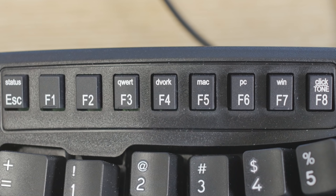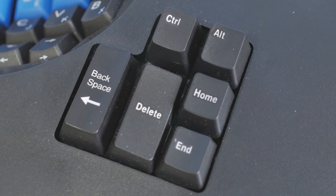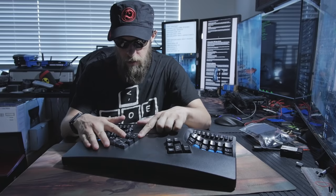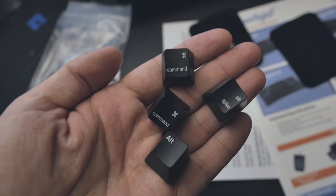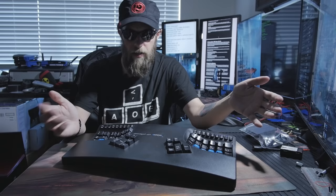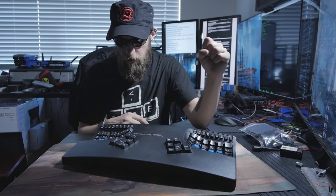Another basic feature of this keyboard is if you hit program and then either F5, 6, or 7, it puts it into Mac, PC, or Windows mode. You can also adjust the layout of the keys down here — it's mostly just your control and alt keys. Program F5 puts it into Mac mode, which changes your control keys into command keys, turns the window key into a control key, and this key into your alt or option key. Program F6 gives you controls and alt on both sides — it says PC, but it's basically anything that's not Windows. The default is program F7, which puts it into Windows mode: control keys, alt on one side, and the Windows key on the other.